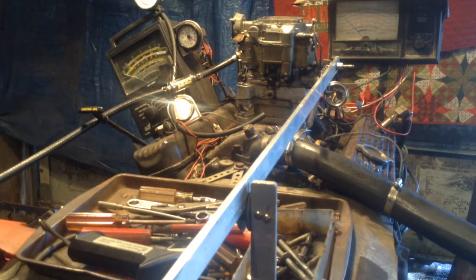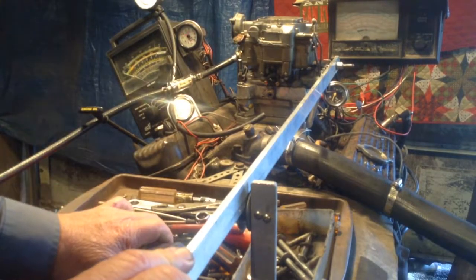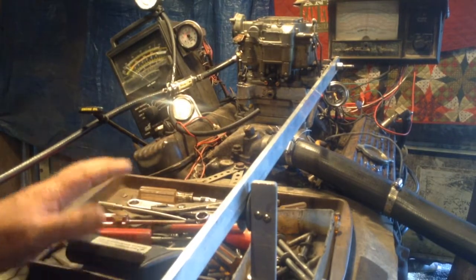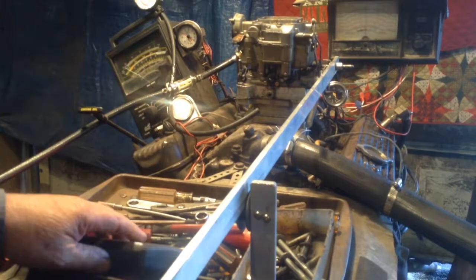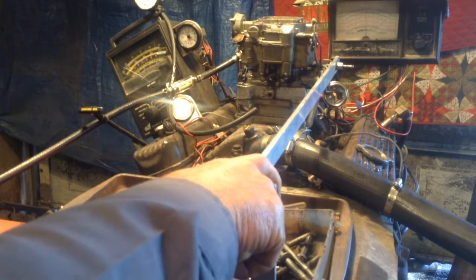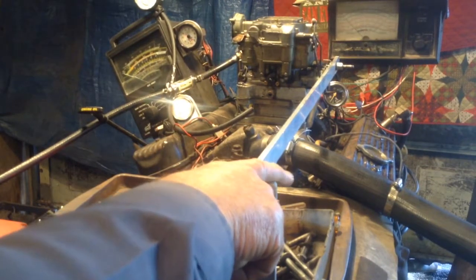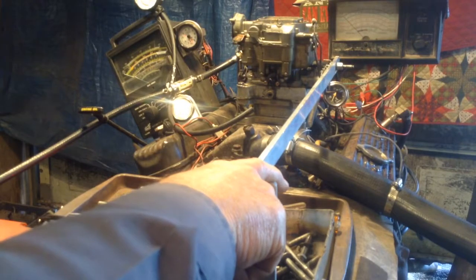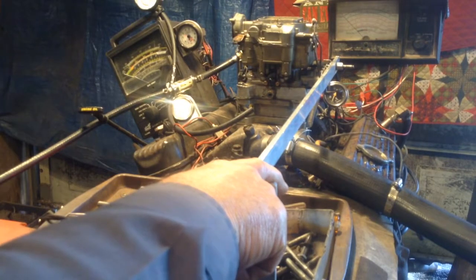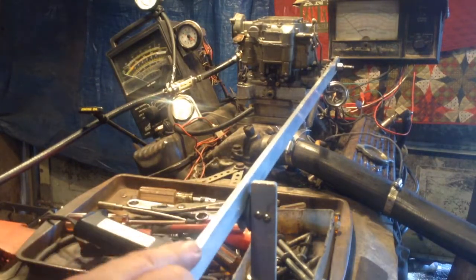Anyway, we've got it running and we can start it right up. It's idling — it's just typical of those air carburetors. You would get them every day. But when we try to accelerate, it'll cough and quit. And if we continue to try to accelerate, it'll backfire and blow our lights out and set our ceiling on fire. So we're going to try it one more time, and we're going to tear into it, Robert.